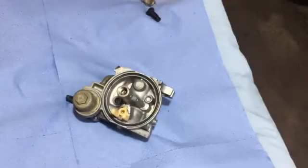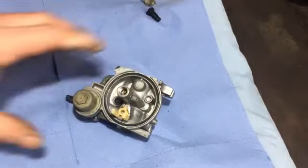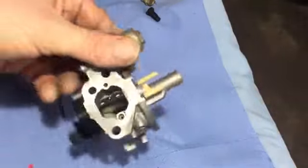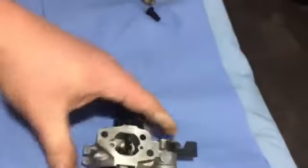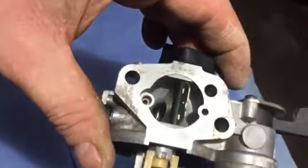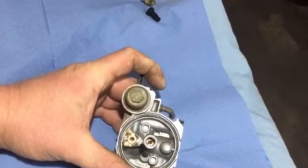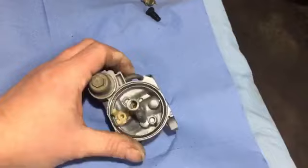One thing before I forget, when you're using carbs around blowing out, put safety glasses on and gloves, really. I've run out of gloves, which is a bit irritating at the moment because I don't like getting it on my hand. I've tried to do as best I can without getting it on my hand, but I have a little bit. And now I usually, when I just screw that in, I just blast the carb spray through, just in case when I'm putting it in, something actually comes off and goes in the hole. So that'll be fine there.